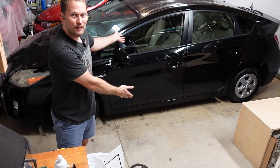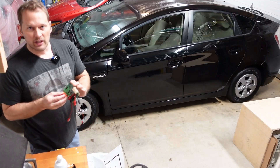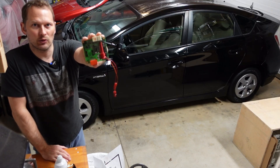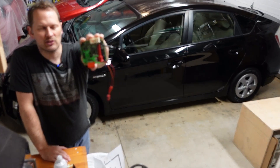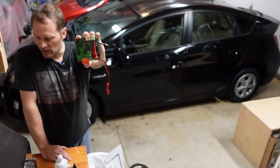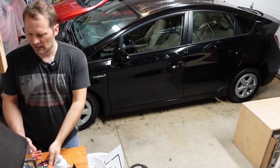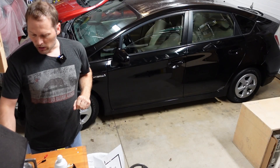I bought a Prius - we're going to get to this Prius project. The goal is to replace the OEM BSU computer, which controls battery voltage, current, temperature, and high voltage isolation resistance. We're going to replace this entirely so that we can use lithium batteries in Gen 2 and Gen 3 Priuses and the Prius C - the nickel metal hydride Toyotas basically.